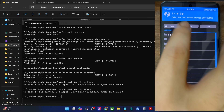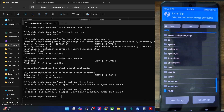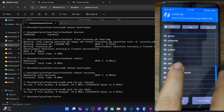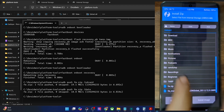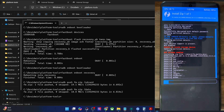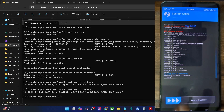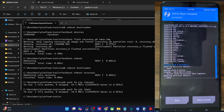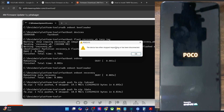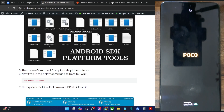Once the file has been transferred, simply choose the firmware file in TWRP and swipe to flash it. The flashing will start and take only a few seconds. Once flashing is complete, it is recommended to tap on 'Wipe Dalvik Cache' as well — while not compulsory, it is highly recommended. Once done, tap on Reboot System and your phone will reboot to the newly flashed firmware. Do keep in mind that the first boot may take some additional time — that is completely normal. From subsequent boots, that will not be the case.